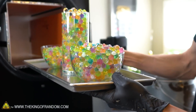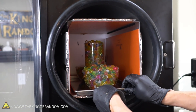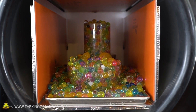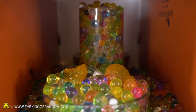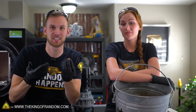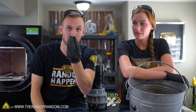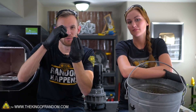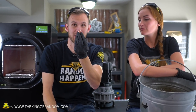As we've explained in a couple of other videos, a freeze-dryer works by lowering the temperature and freezing whatever is in the machine, then it pulls a vacuum and warms up a little bit. As it warms up, all that frozen liquid in there gets turned into a vapor - it sublimates, like dry ice turning into a vapor, but we're doing it with water. It does that at low temperatures and very low pressures, so it just sucks all of the water out of something without it ever getting wet.